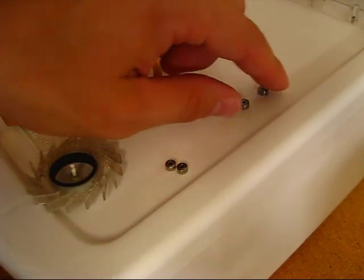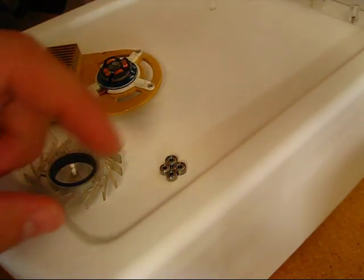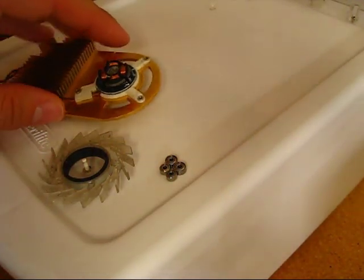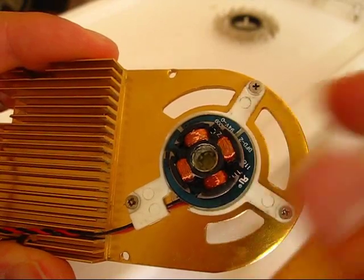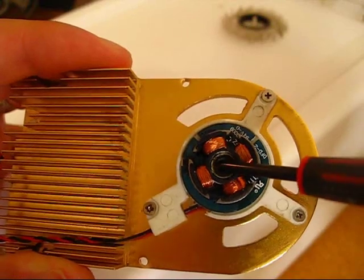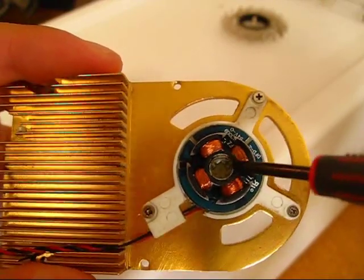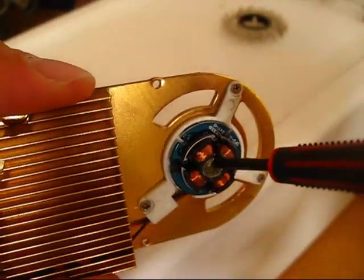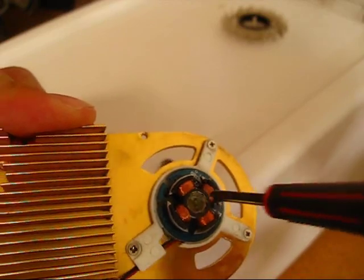Here are my two old bearings, and for comparison, two new bearings. I hope they're not too big around. I'm figuring on having to rework the inside diameter of this housing to get them to fit. I ordered oversized diameter bearings because I knew I had kind of messed up the plastic bore on the inside when I was working on it the first time — I tried to push in some brass bushings and kind of junked up the side. So I'm going to oversize this hole, though I haven't totally figured out what tool I'm going to use.